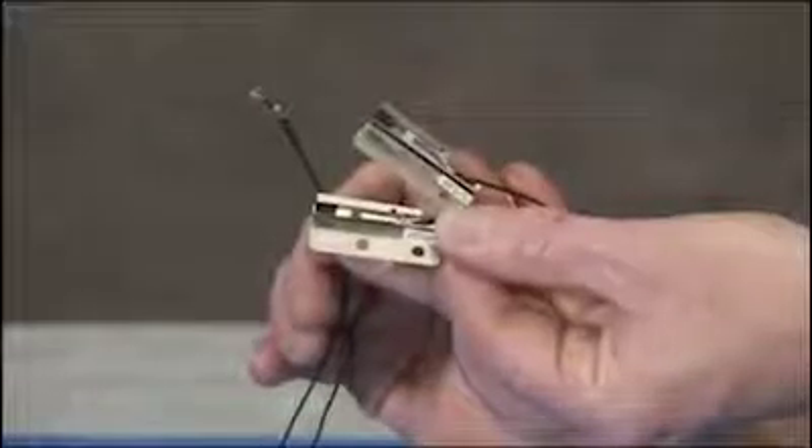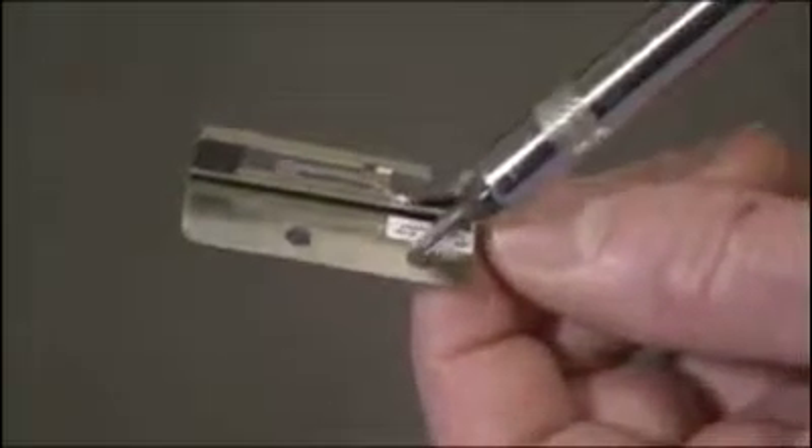When installing wireless antennas, install the new antennas in the locations marked ANT1 and ANT3 on the top of the PC. Each location has a locator peg that fits into a hole on the antenna.